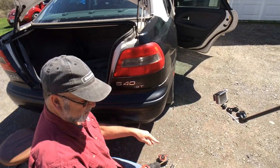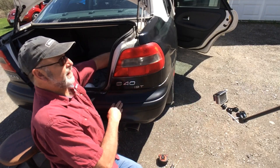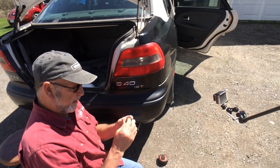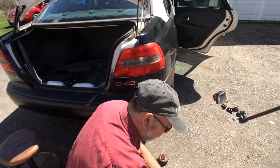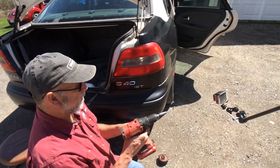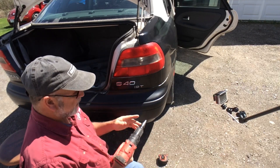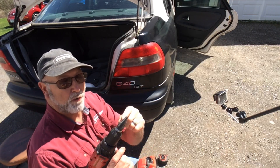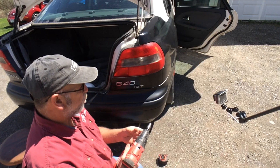I went all the way through because I know I'm going to have to do that anyway inside, and I also need the pilot hole so the unibit can bite into the metal. Go ahead and take the unibit, put it on, and you're going to have to find what size setting you want. I'm pretty sure I know which step it is, but I'll go slow.